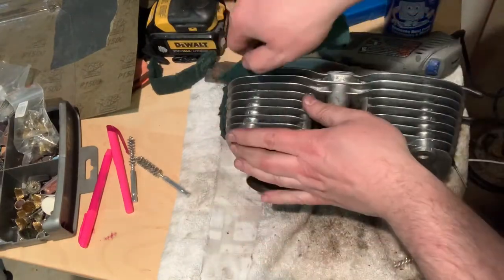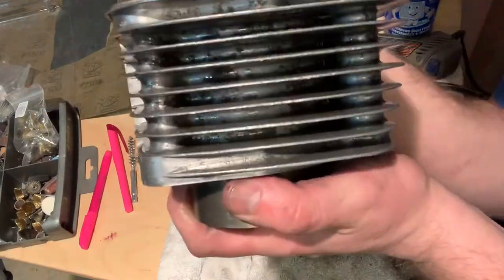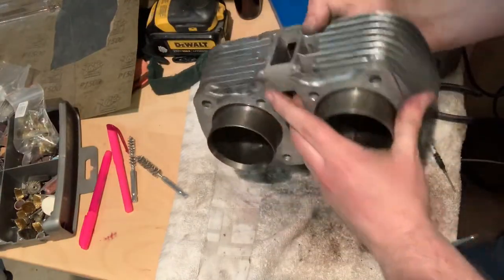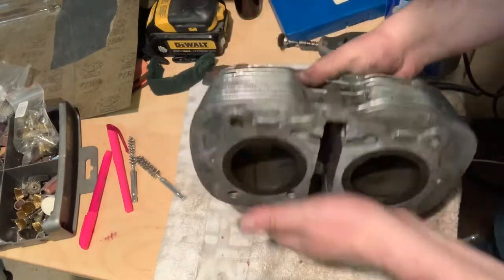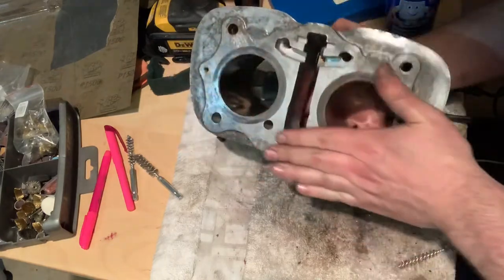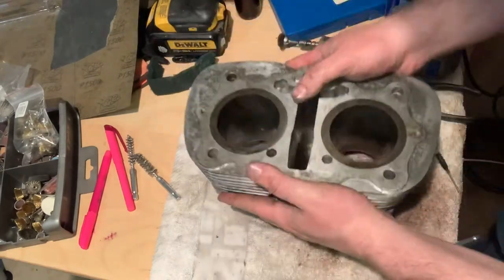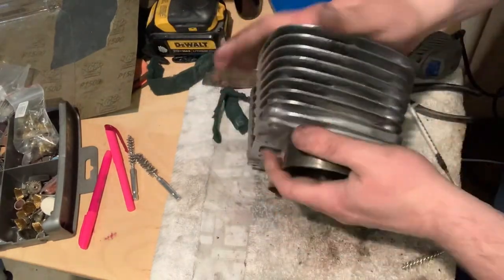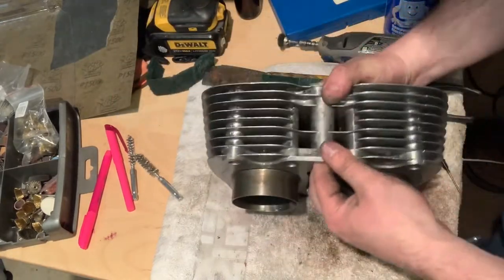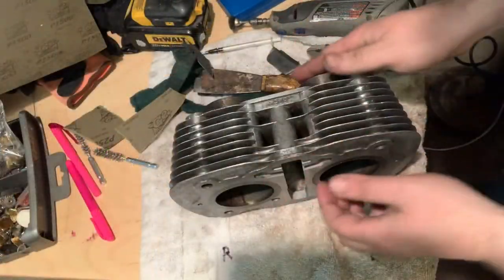But again, am I just over-engineering here? Who in their right mind is walking up to your bike saying you didn't do that? The cylinder jug — as they call it — my surfaces are all good. I've got to replace the O-rings and hone it, and then I can get the cylinders back on the bike. But I just don't want to throw something on here that's not perfect. I might absolutely be losing my mind.